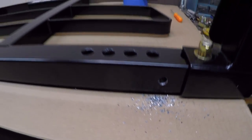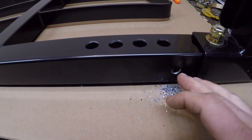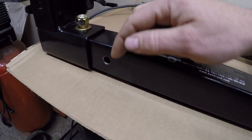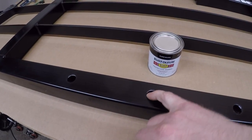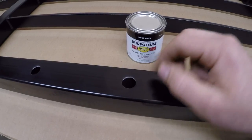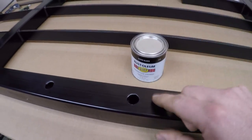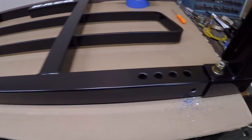With that, I got all the holes drilled — I didn't bother showing that part. I also put a couple of half-inch holes down on the bottom at either end for the circuits, so the wires are gonna have to go in there and power all these lights. Next step is to deburr the rough inside edges of these holes to reduce the chance of any wires chafing on sharp metal, and then touch up that bare metal with some black paint.